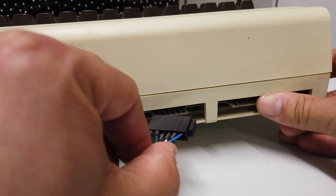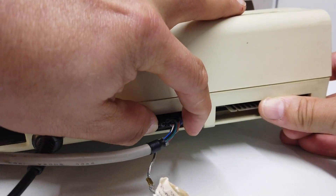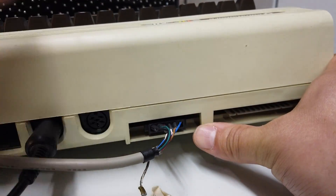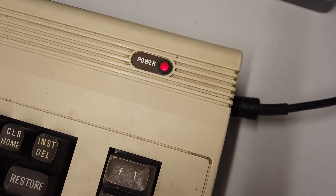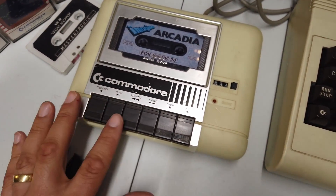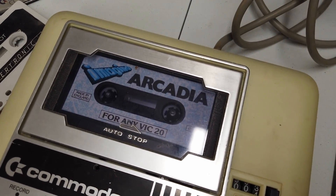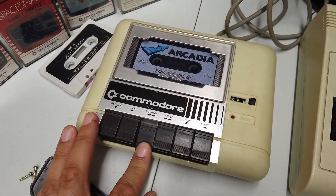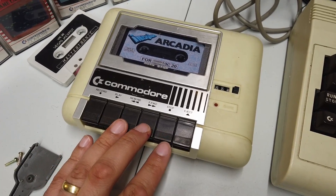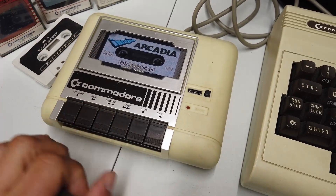Having cleaned up those contacts, let's plug that card edge connector in and just see if that's fixed our problem. And there we have it — you can see the red LED here. Now let's have a look — does the tape player work? Oh, great news, it absolutely does. I can see a tape moving. Let's go ahead and test the functions of the tape machine. Fast forward works, rewind works. Clearly we don't want to be pressing record on a pre-recorded cassette tape.